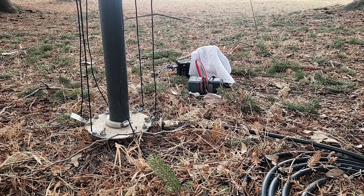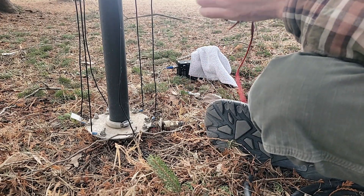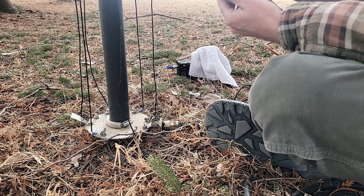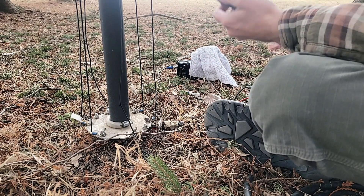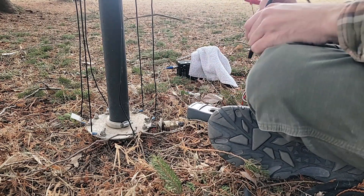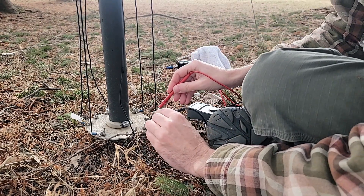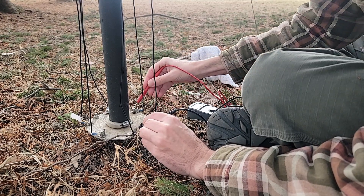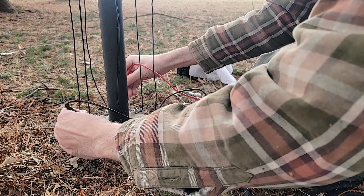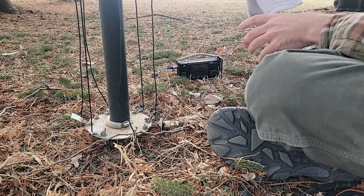Let's see how well this works here. I'm kind of just checking the basics right now. I'm not 100% sure of what the right answer is going to be. So the next thing I want to do is check continuity between the two plates to see if something's grounding them out. Put my trusty multimeter on continuity mode. The plates are not connected. Let's make sure the elements are connected. Yep, all the elements are connected.